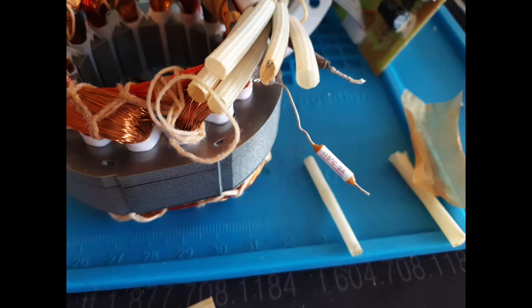I had a spare fuse that was very close in terms of temperature rating, slightly higher in amperage, but I wasn't too concerned about that. Remove the old fuse and place the new one in circuit. Soldering can be tricky because the fuse is rated at around 113–115 degrees, and soldering at a higher temperature might blow it. You have to do it very carefully — try using a heat sink like an alligator clip to redirect heat away from the fuse. I ended up quickly soldering one end, and on the other I just wrapped and cinched it down so it wasn't actually soldered, to avoid the risk of burning out the fuse.